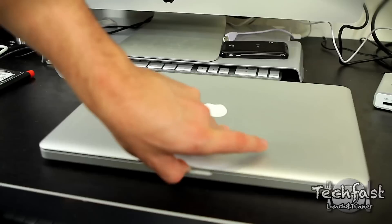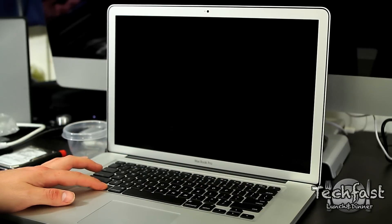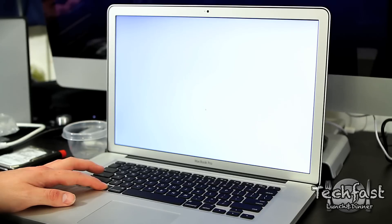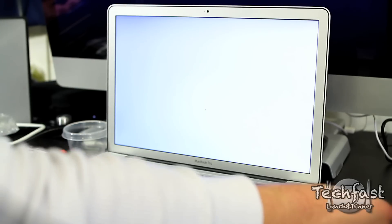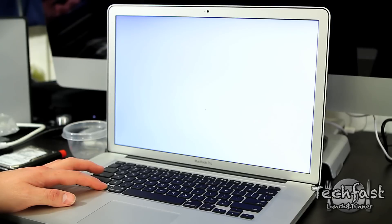Now that we're all done, flip the MacBook Pro open and turn it on. I'm going to walk you through doing a fresh install of the OS. Hold down the Option key until the gray screen appears, then insert the disk while continuing to hold Option. This lets you choose your boot preferences, and from there you can select the Mac OS CD and click it.